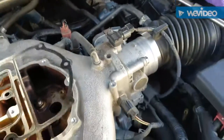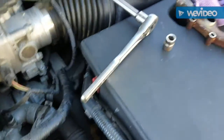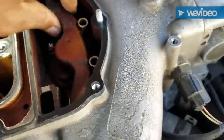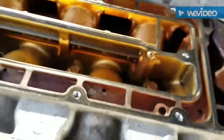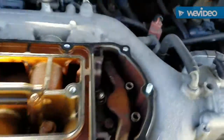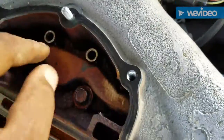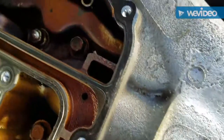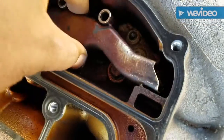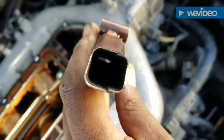Once you take those bolts off, it comes right off and you'll see it sitting like this. The gasket will be here, and then there's this piece that sits inside. It's very simple — this doesn't take long to do. I'm just real tedious, I want to make sure I get it right. There will be two 10 millimeter bolts right here holding this valve piece down, and that lets you be able to see the hole once you take those two bolts out and pull out this piece.